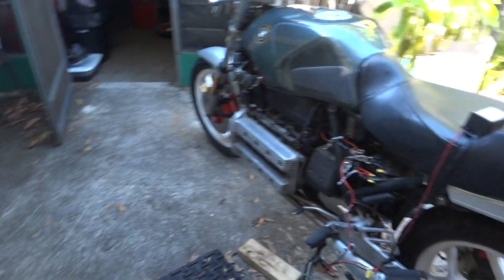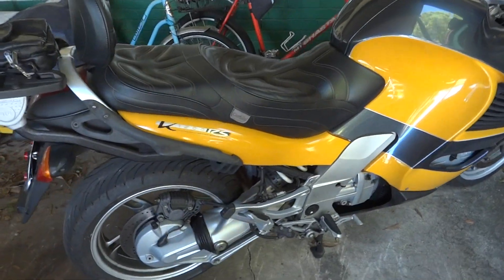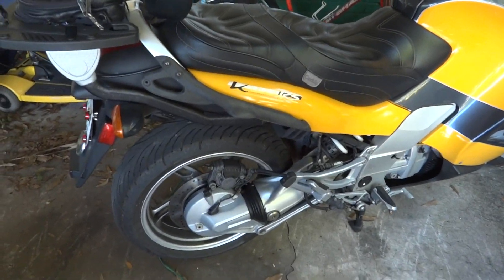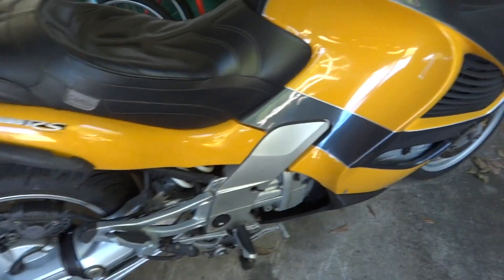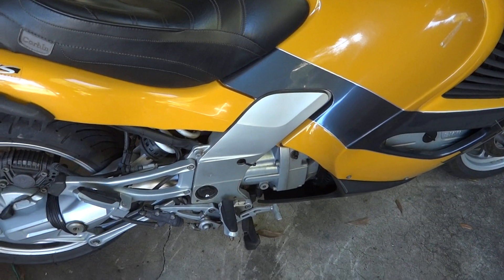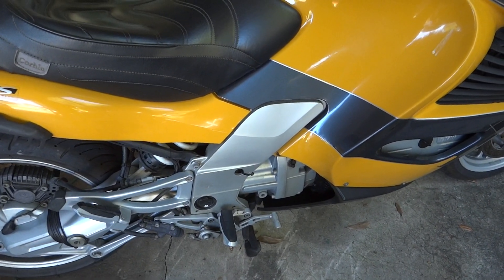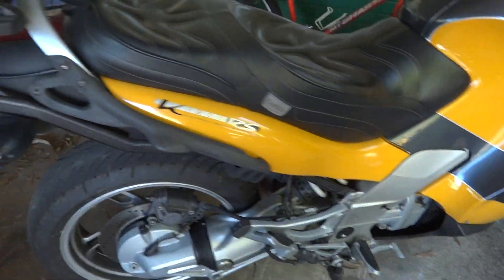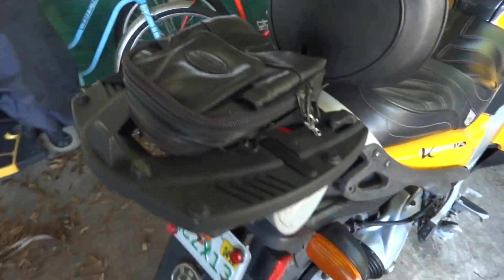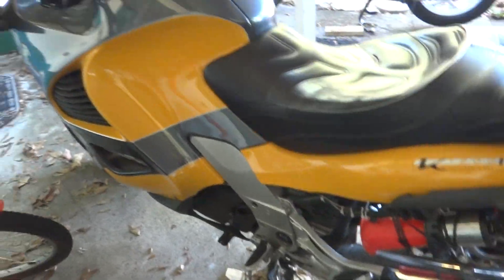I've just done an update on my 1985 K100 BMW and now I'm giving an update on this 2001 K1200RS. This is what's known as the Coca-Cola bike. I cured the clutch slip by putting Coke in the clutch housing and flushed it out several times — left it in for 24-48 hours and it cured it. I mean completely cured it, probably over a year since I did that.